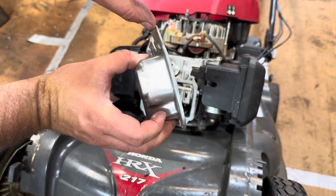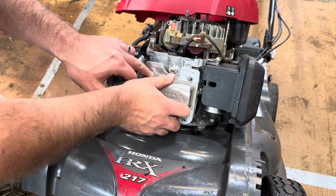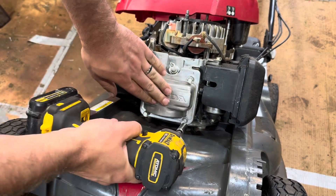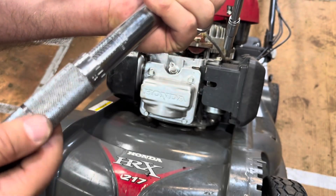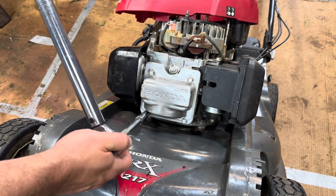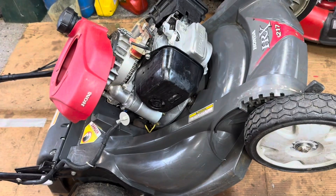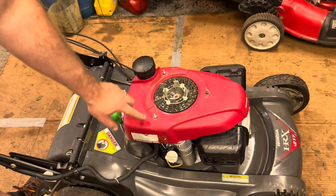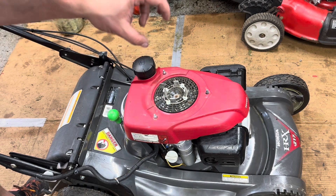Make sure that if the cover gets bent when you peel it off, you straighten it back pretty good. Got our four bolts back in — I'm just going to snug them with my impact, then set the torque wrench to about 10 foot-pounds. Common sense if you don't have a torque wrench — it's not a big deal. I like to add a little bit of anti-seize to these bolts, otherwise when you go to take the nuts off it'll pull the whole shaft off and we don't want that.